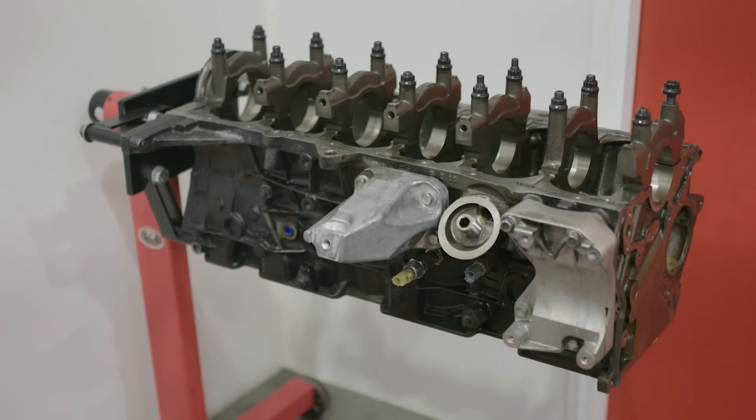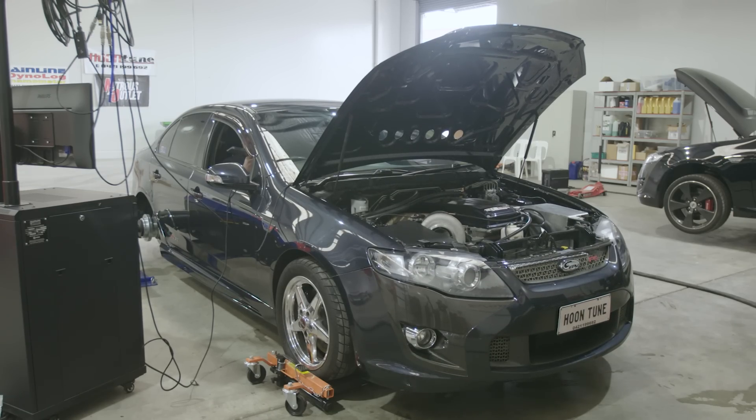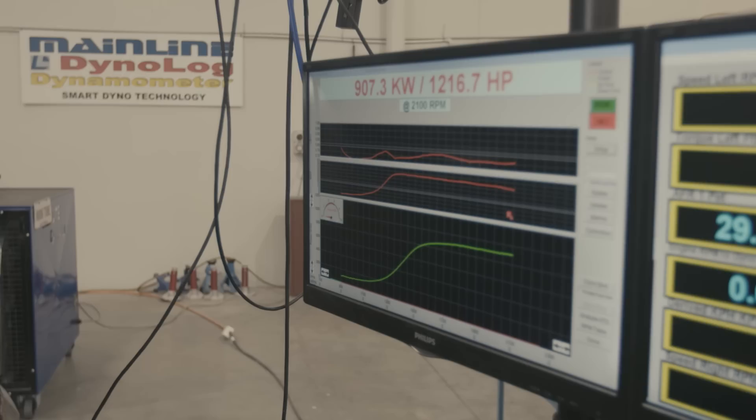We go head studs over 400 kilowatt in a stock motor and that'll happily take you up to around 500 kilowatt, but the block itself is not an issue there. Head studs — 916 head studs at about a thousand horsepower. Grout is the same sort of story, it's an option. I have gone over a thousand horsepower to the tyres without it, but for that safety factor it's not a big issue to put it in. Just put an oil cooler on at the same time to keep the temperatures down in the bottom section of the engine. We haven't broken any blocks over a thousand horsepower — we've done probably 15 over a thousand horsepower and well over 300 below that with no issues. We've made around 1,700 horsepower at the crank without an issue; the block wasn't the issue. Other performance shops are showing over 2,000 horsepower and they're running into other issues, not the block — cylinder head issues and things like that, but not the block. At that 2,000 horsepower mark we'll probably start seeing some billet Barras, but up until now we haven't hurt one and we're going to keep pushing the cast blocks until we do.